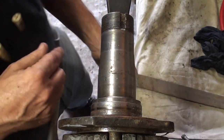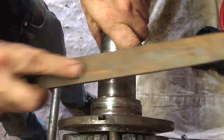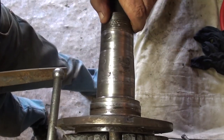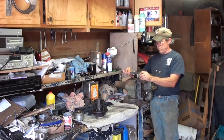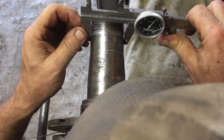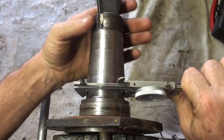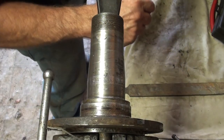It's somewhat depressing. I'm going to move on to where the race rides — all buggered up. So that kind of gives me a starting point, a visual overview. There's some hammering going on there. In the unscathed area: 2.809 inches. In the scathed area: 2.808. But I need to turn to the worn spot: 2.805. And on the big end, I've got 4 thousandths depression.